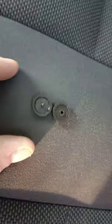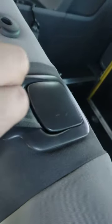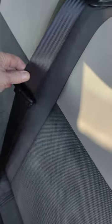You can buy the rivet online. You want a bit of slack on the belt and then the rivet needs putting in so that it won't go too far back. When you fold the seat down, it makes the distance shorter so the belt retracts in, and then when you want to lift the seat upright again, it won't do it.